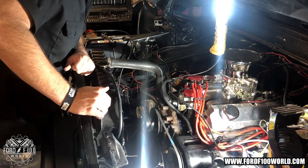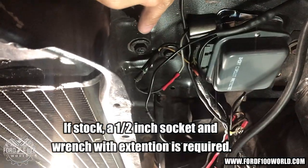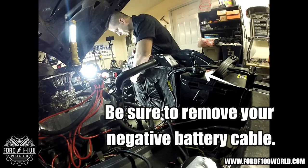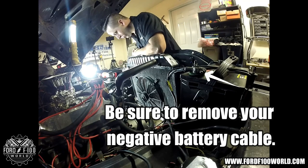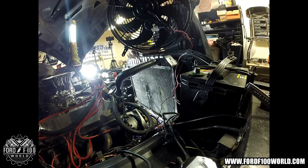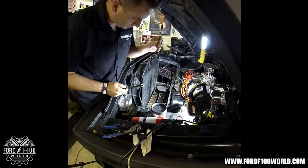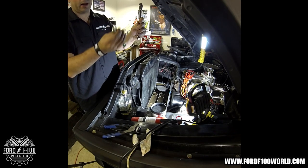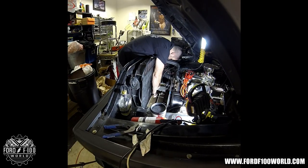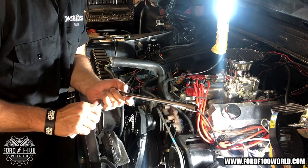This hose actually just failed on me, so the timing was odd. I bought a new kit — going to cut these off and remove the fan. This fan is an eBay find; I thought I'd have trouble with it but honestly it runs great. For your transmission lines, if stock it's five-eighths on one end and half-inch on the other — hold the big end and rotate the half-inch end so you're not twisting the line.